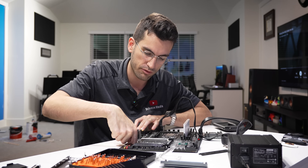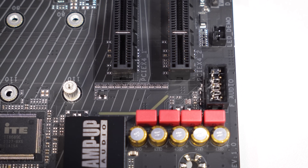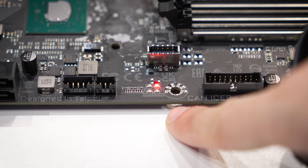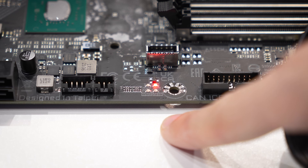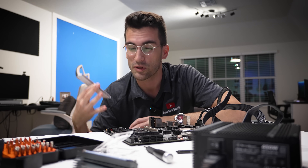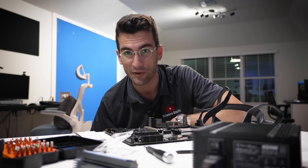The sound chip itself isn't hot. What's warming up seems to be tiny resistors or capacitors near the lower PCI slots — they are hot to the touch and I have no idea why. That is super strange. Also, it even throws a CPU debug LED with no RAM installed at all, so something is so catastrophically wrong on the CPU side that it doesn't even have time to check whether DDR5 is installed. The chipset is warming up despite the CPU remaining stone cold — it's like it's trying to initialize things but isn't able to. We are cooked, folks.